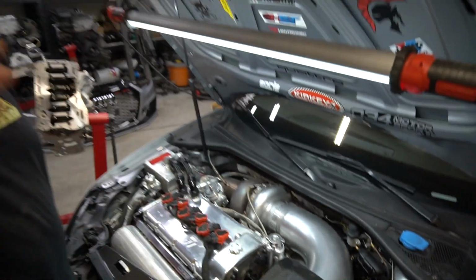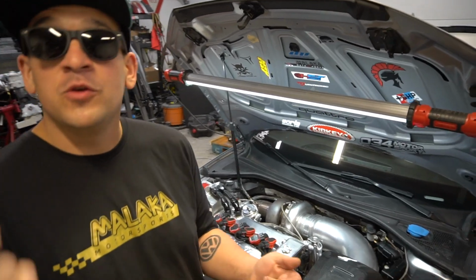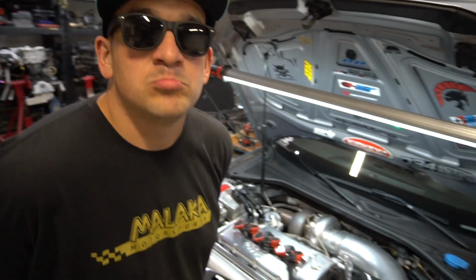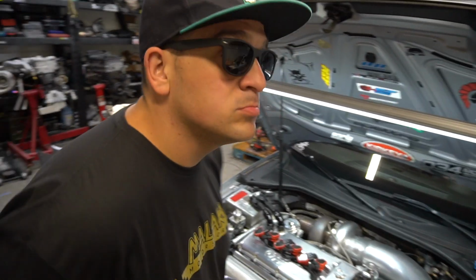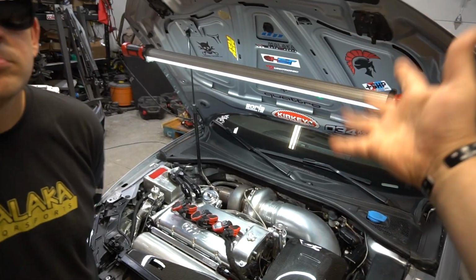Let's be honest. You want to relocate the ECU, and now you're giving me more work to do. And then on top of that, you want to add things like fuel pumps in the back, surge tank, nitrous, turbo speed sensor. We're running a surge tank, a Radium surge tank, and we're going to talk about that here in a second. We're running a Radium surge tank in pretty much all the B5s. You have pretty much a dual pump surge tank in your car. It only makes sense we run a surge tank here because the stock tank just really sucks.